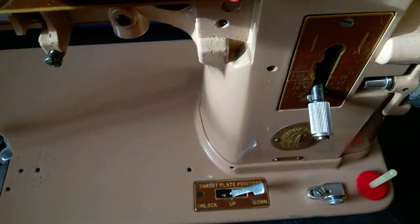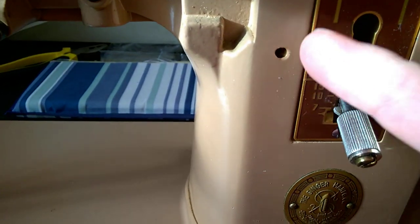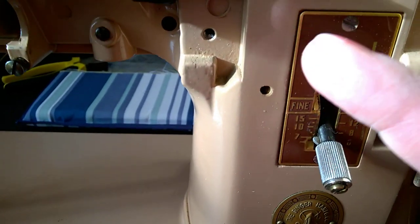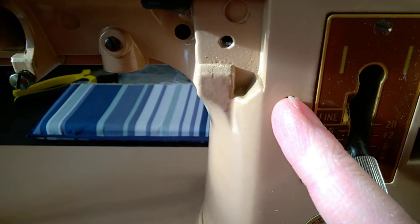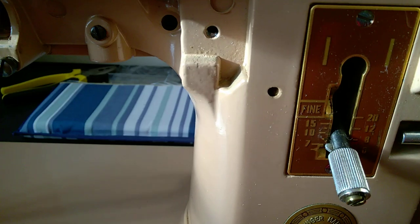And these 2 holes here, I'll continue with the other holes too, but these 2 are not just neglected, but most of the time people would just keep the machine standing and put oil, and the top of this sleeve doesn't lubricate properly.